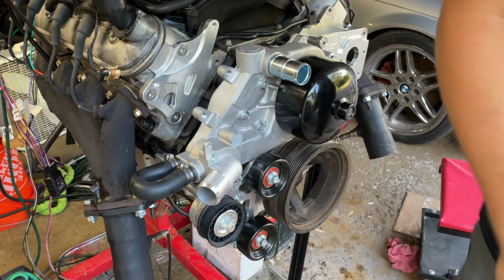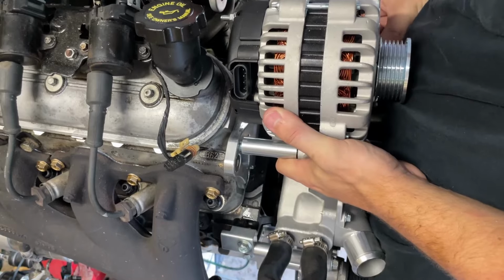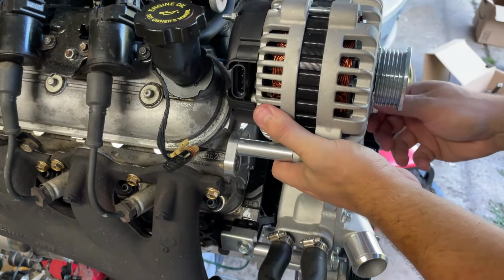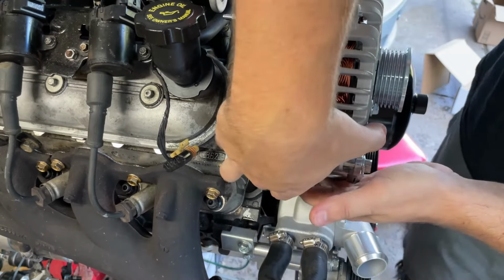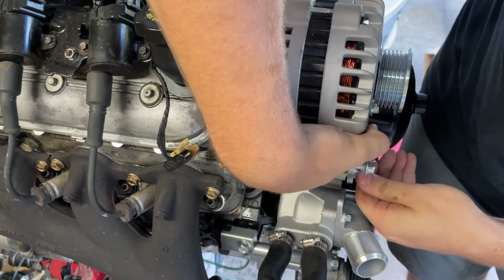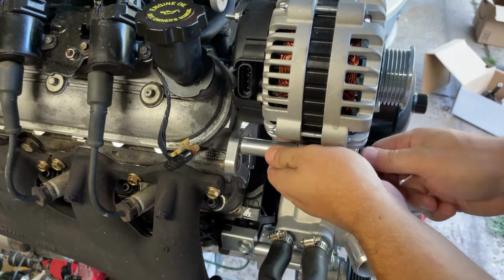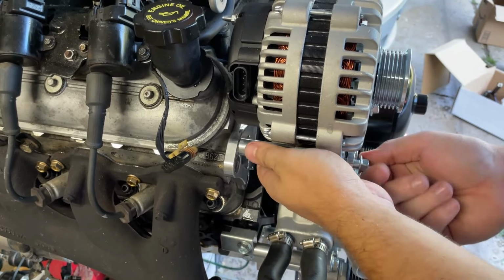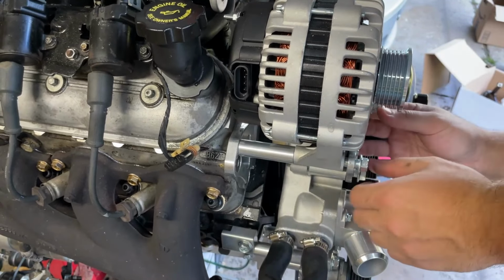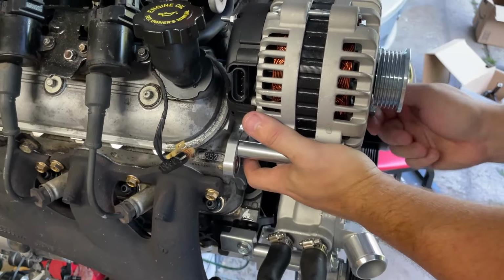Fun when it just bolts together, huh? This one's a bit complex because we're going into this bracket and the water pump. So I'm hoping all my spacers didn't fall out. I'll go over all the spacers in a second. L over D ratio on these bolts is nutty, so I'm not too concerned about them falling off. However, they are threaded in aluminum.